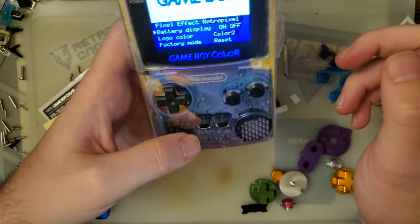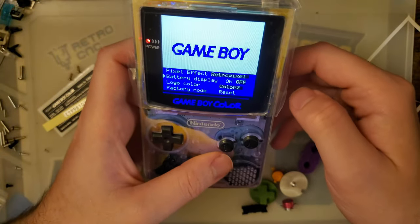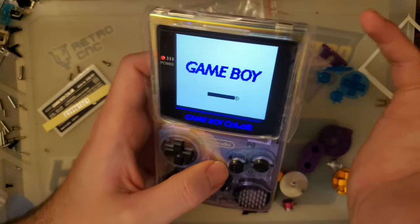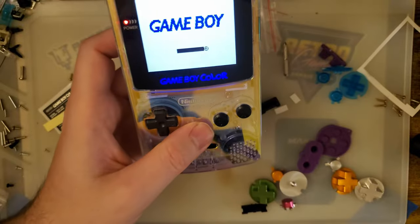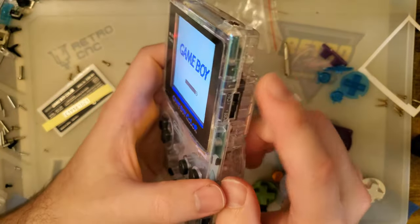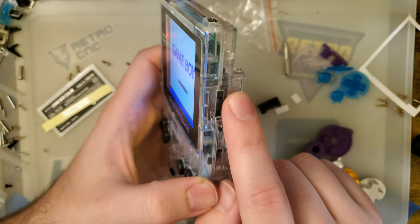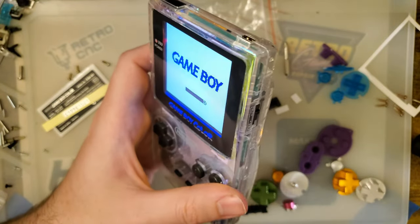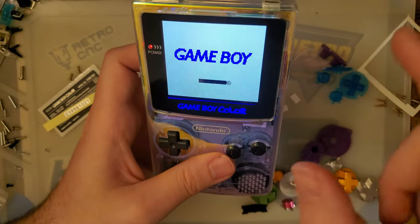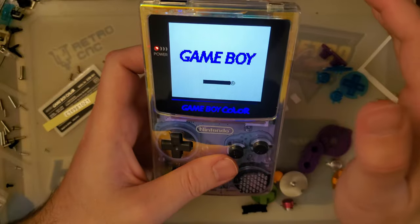That's important because, like I said, some of the other older kits did manage to corrupt pretty easily. One of the most common things that I've seen that causes that corruption is, let's say you have your touch sensor right by the power switch. Every time you hit the power switch, you might trigger the touch sensor. If you change a setting and the kit is saving those settings on board and you switch it off before it completes saving, that data is going to be corrupt.